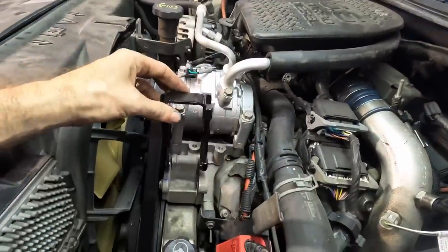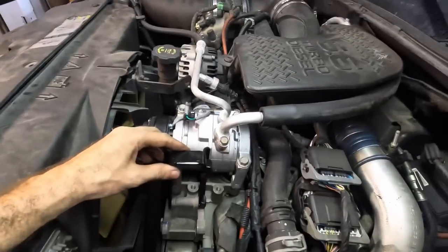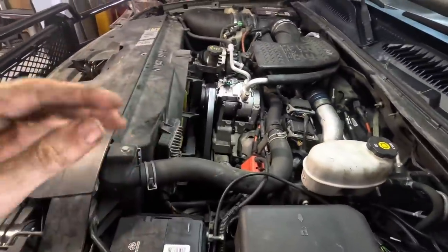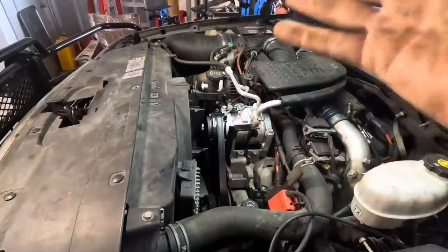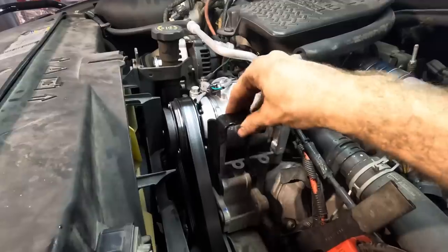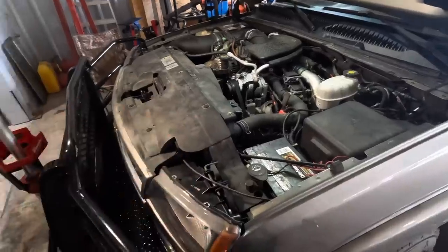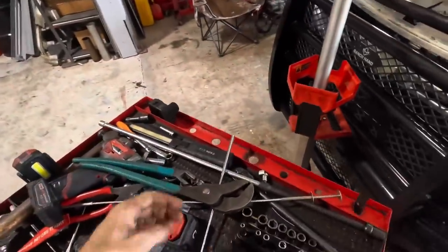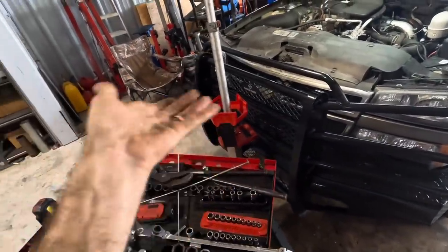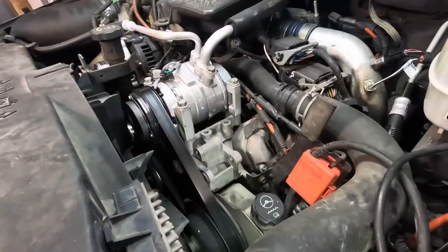I would not get an entire week of power from a regular gen set because it burns through gasoline fast — five gallons in an eight-hour period, and I can't sustain that 24 hours at a time. The idea is to run my gasoline generator during the daytime, then at night switch over critical things like fans, lights, and refrigerators to run off the truck's power supply. The truck is also much quieter than a generator, so I don't have to advertise to everybody that I have electricity — and that's my reasoning for having the dual power supply.